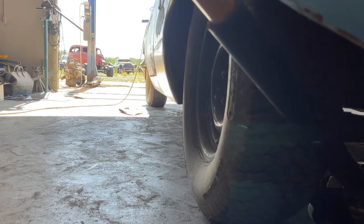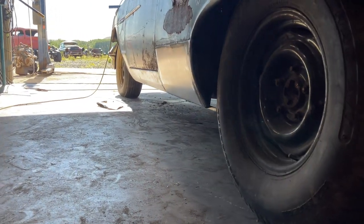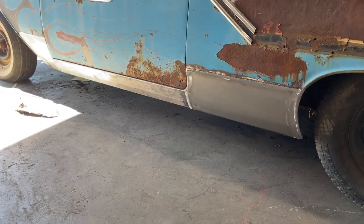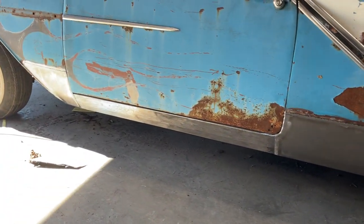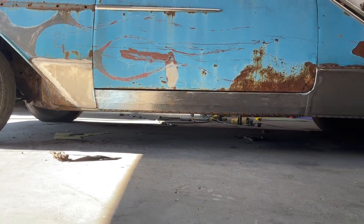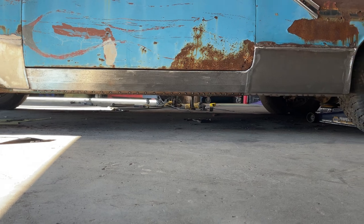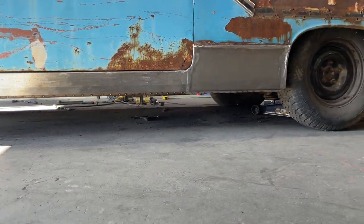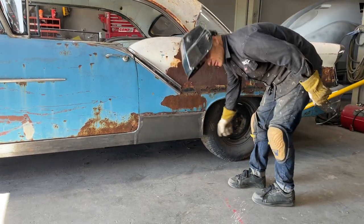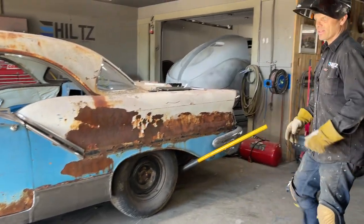Did not smash it. The hammer work is not really needed on auto body panels. A hammer is really not needed unless you're shaping something that has compound curves. If you're trying to put some shape in it, yes, you bang it around a little bit and then you try to wheel it out so it has no hammer marks in it. But stuff like this, a gentle roll like that, and a bend here and a bend there, and a butt weld with a 90 on, you can make some wonderful things.